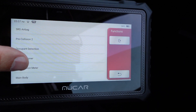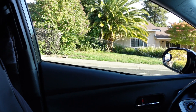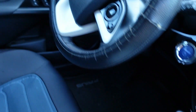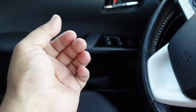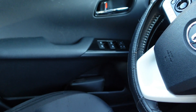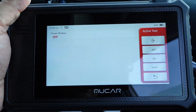You can do this for lots of different items on the vehicle. I'm showing you the ones you can actually see, like the driver door. Now I can roll the window up and down just by using that. Let's say it rained on the master window switch and nothing was happening and you were about to order a new motor — well, you can be pretty much guaranteed now that you don't actually need a new motor. You might need a new switch instead. And after you put the new switch in, some vehicles will require a reset, which you can also do with this scan tool.